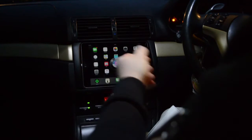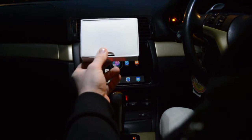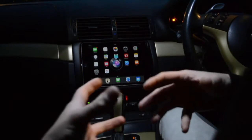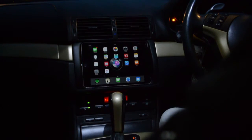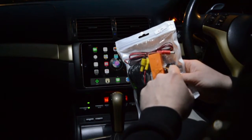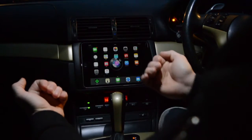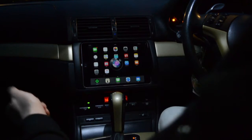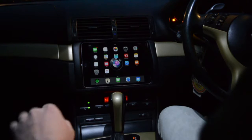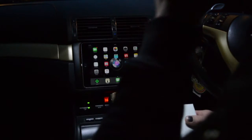Because you can't connect to an iPad physically through cables, it uses a Wi-Fi transmitter. You join it all together — the kit comes pre-joined. You drill your bumper at your chosen location, push the camera into the hole, run the cables underneath the bumper, tuck them up, pull through to the back section of the boot where your CD changer is on the left, and install the Wi-Fi transmitter there — it's the perfect location.